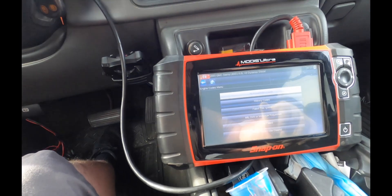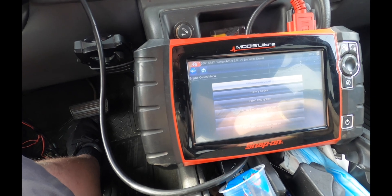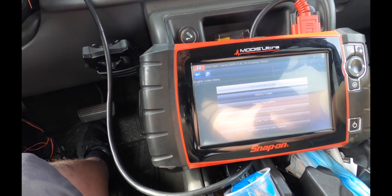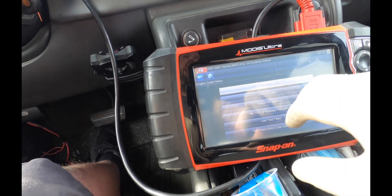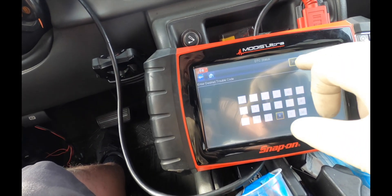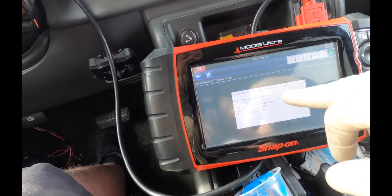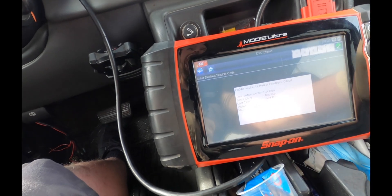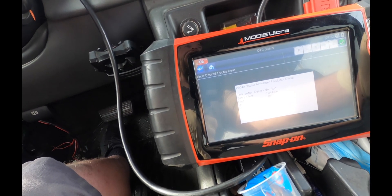My only concern is that there was a reference voltage on that terminal — about 4.6 volts when you unhook it — which could have hurt the computer, but it seemed to work just fine so I doubt it. I just don't understand why the scan tool shows no feedback when the voltage does change. It might just be the way the strategy is in the computer — sometimes it's a little weird. I'd like to see the truck command the heater on itself, draw the current, and then check the DTC status. On GM you can go in and check if a code passed or failed — that's one thing I love about GM. It was P0540. It hasn't run yet so we're not 100% sure, but it'll say not run, failed, or passed. I'd like to see it passed.